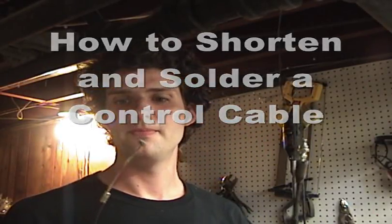Alright, now what we're going to do is shorten a control cable. I have an old clutch cable here that I'm just going to chop for demonstration purposes. Let's say you want to make this a little shorter. What we're going to do is cut the barrel off. We're going to take this little sleeve off and we'll reuse it. Then you're going to cut your sleeve.